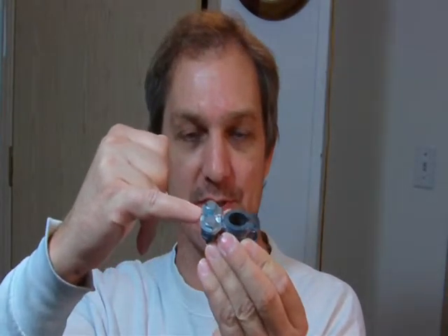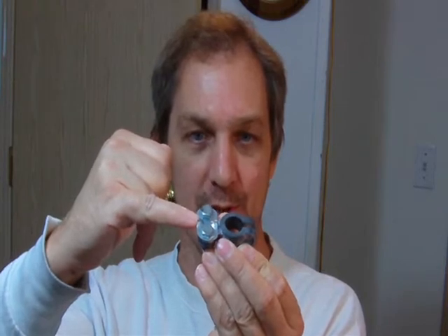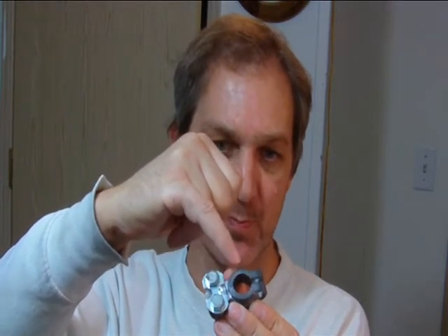There are a bunch of other tools that you need. First thing you want to do is clean all the corrosion off. When you see the terminal ends — this is a universal style — right where the wire goes into it is kind of a poor connection, but this is just a do-it-yourself repair job. Where the cable is, you're going to see a bunch of white scum, blue and green colored stuff. You want to get that off. Sometimes you'll see a real black substance that's really hard to scrub off. What you want to do is put about a tablespoon of baking soda and a pint of water, dribble it on there, and it's going to really foam up and start dissolving that stuff. Then take a stiff brush and scrub it off. You want to wipe down the entire top of the battery, get all the dirt and acid residue off, and hose it down.